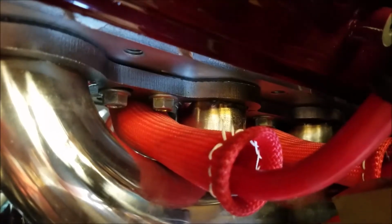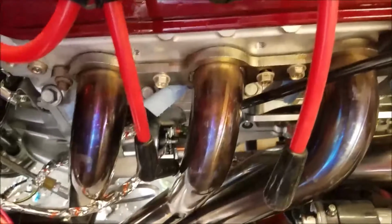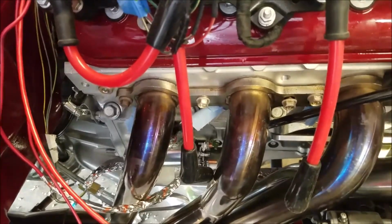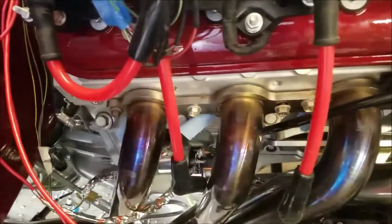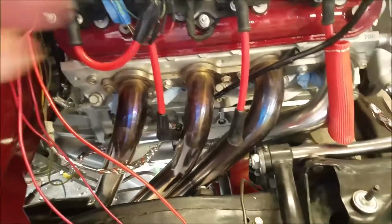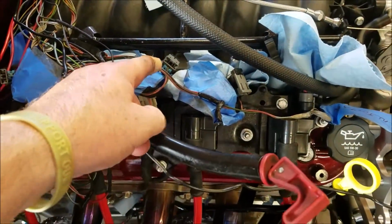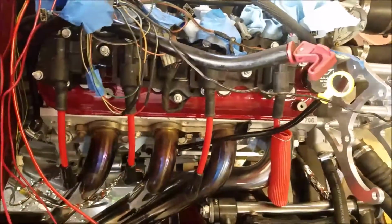I look in the back. Yeah, you're just gonna have to trust me. So, all cylinders were firing, but these 3 were extremely hot, which is bad. So they're running, I'm gonna say rich, a lot more than the others. Also, I pulled off the boots and the spark plugs and the injectors. So we're going to test the injectors today. That's the whole big thing.